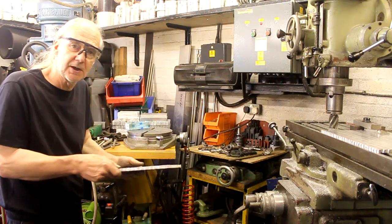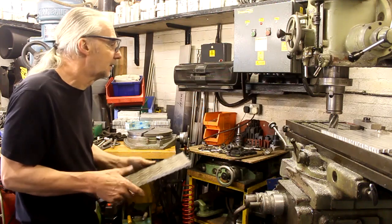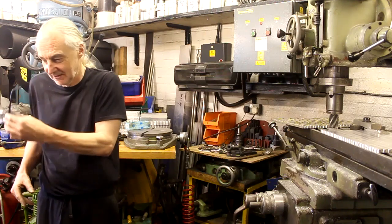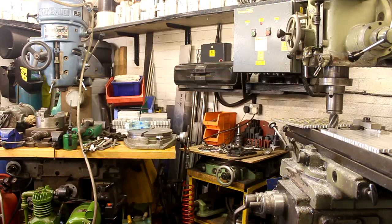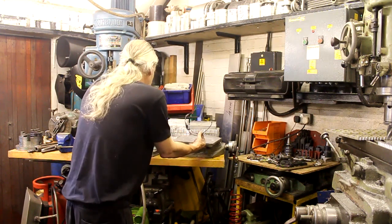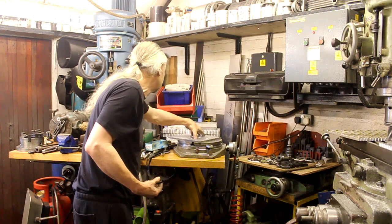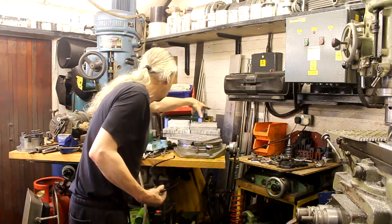So it's an adapter plate to make a clutch. How did you make the old one then? Because you made one before and you didn't use that. Yeah, but yours, the Kawasaki Z1000, is different to the GPZ. Because I've had one before for the GPZ. I'll show you. That one's the GPZ one. So that's your fixture that bolts on there. And then once it's got the centre in there, you dial everything in, and that fits on.